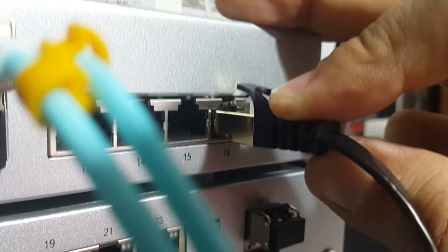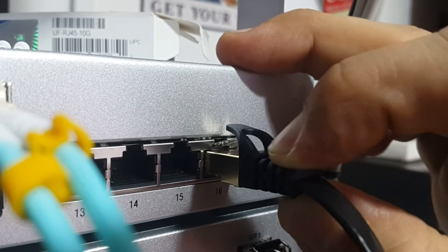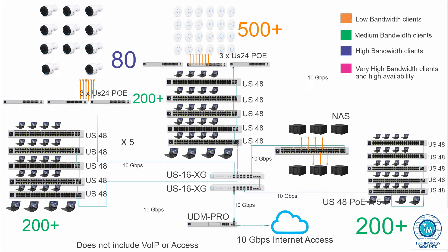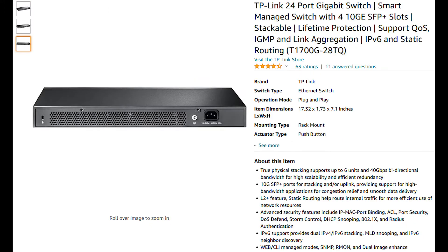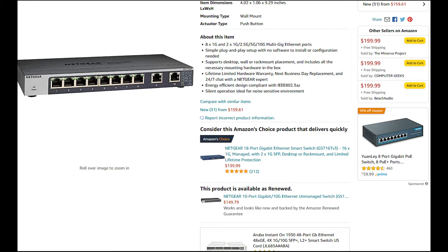Those four ports are for 1 gigabit or 10 gigabit per second — this switch is designed for much more robust networks. You have a lot of options in the market right now, and prices have dropped incredibly. We encourage you to explore these devices, which can give you 2.5, 5, or 10 gigabit per second — or a mixture. Just be careful to confirm that the switch supports 2.5 gigabit per second, as, for example, the US-16XG does not.